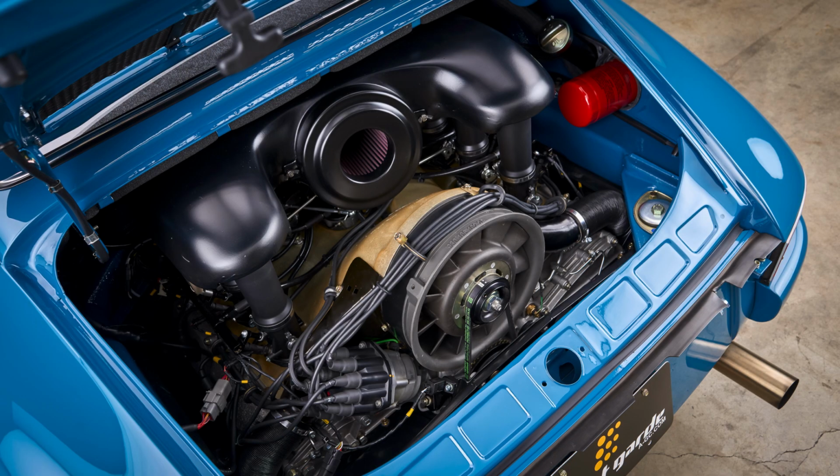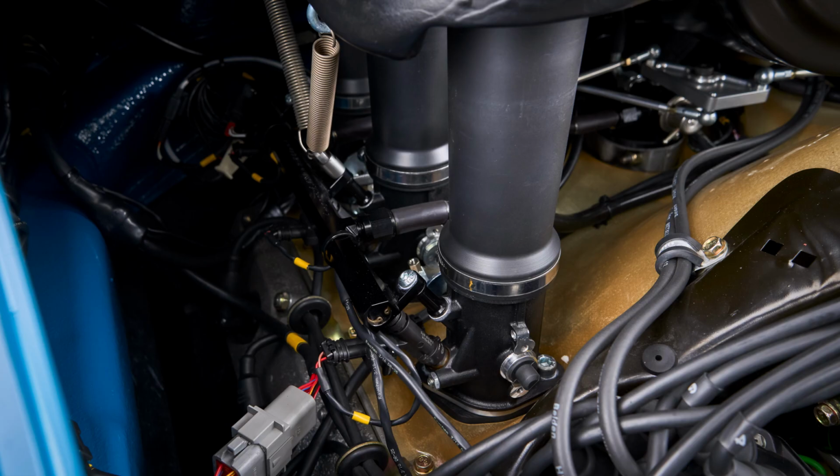The engine is a 3.2 short stroke twin plug. The long block was built by Mark Young of MFI Works. Great engine builder, and obviously he's the MFI pump master. But we wanted to go with modern, obviously Bosch Motec fuel injection. So we have Gamroth's bolt-to-head throttles and Bosch Motec. It's all Bosch EFI. And we've got the tall stacks with this custom, I call it an SCRS looking air cleaner.